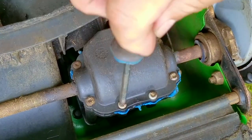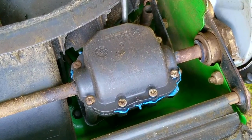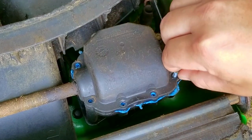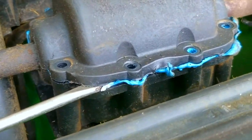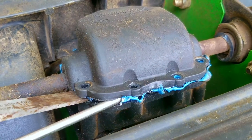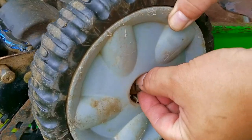To remove the cover on the gearbox we need to remove all the Torx screws. After that we can try separating the cover from the rest of the gearbox. By the extra sealant coming out of the cover I don't think this is going to be easy — we're going to have to get a little aggressive. I'm going to tap a flathead screwdriver parallel to the mating surface so I don't damage it, because when I clean the mating surface later on I'm going to find a few surprises.